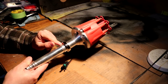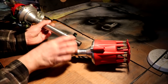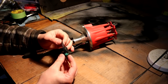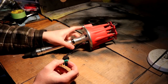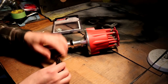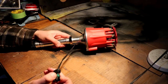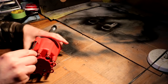You can see this is a slip collar design, and I'm going to take my MSD distributor and match them up to make sure they align the same way. Now, the connector on this does not go to an MSD-type connection, even though it says it's there for MSD-type boxes — this won't work. So I had to pick up an MSD connector kit. I'll have to cut the existing connectors off and put new ones on so it will work with the Phytek. Unfortunately that's a little extra cost — this was $11, so not the end of the world. To get started, the first thing we're going to do is lock out the distributor.